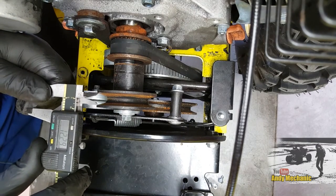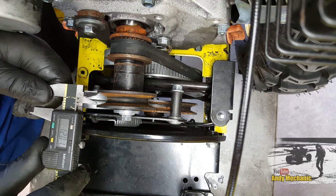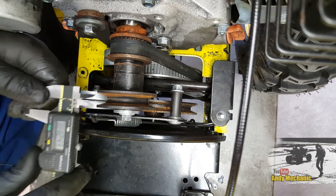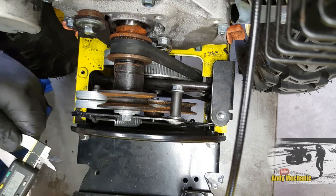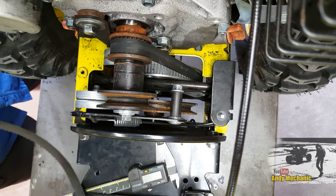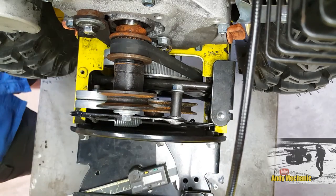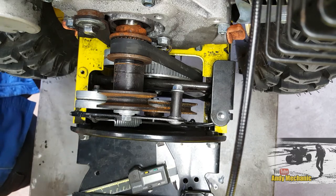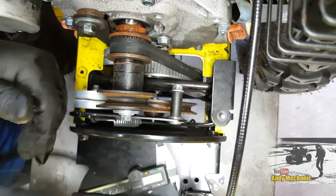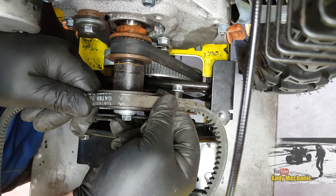Let's go and measure the pulleys. The pulleys can cope with a belt only up to about 12 to 12.5mm. Let's go and see if we can find an old patrol drive belt to check if a half-inch belt will fit in that pulley. This is a 13mm half-inch belt — yeah, that sits in there really well. And if we put on a 10mm belt, you can see it sits a lot lower in the pulley itself, so I don't think that's going to work. We'll do better to get a half-inch belt. Time to get some parts.